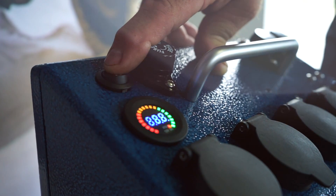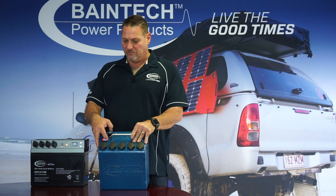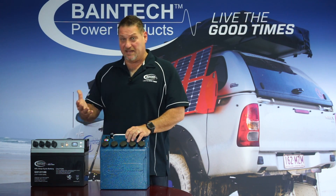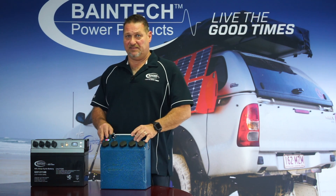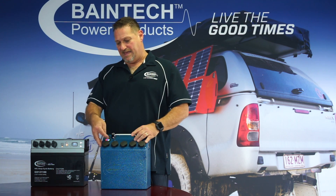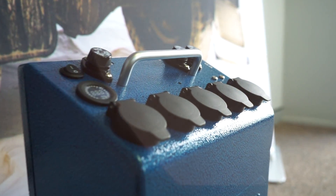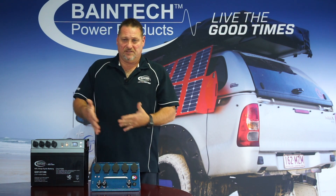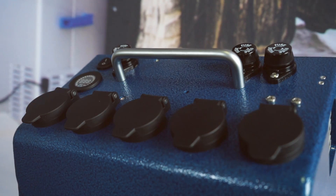With the unit itself, once you turn it on you've got a voltage meter with a battery indicator, which is a nice handy little thing so you can see that whilst you're in the green you know you're at the top end of your state of charge. Once you start getting down in your voltage, these units will cut out at around 11.5 volts — you'll see the voltage being indicated and also your depth of charge around the side. It's a really great, nice and lightweight unit that can also be utilized in the flat position, so if you're limited for height and room you can just put it flat and it'll fit underneath the seat in your vehicle or wherever you want to go.